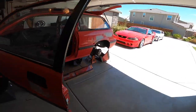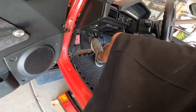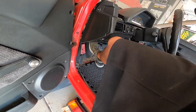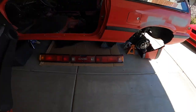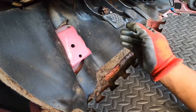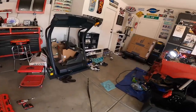The best time to adjust it is when you run the car, because you'll know when the clutch grabs. For now, press on the pedal and make sure it feels like there's tension on there. There's a little bit of a dead spot before it starts to catch, so it's just a matter of tightening it down. The pedal adjustment bolt is more for where the pedal stops — there's actually a little standoff bolt you can adjust to control how far back the pedal stops if you think the pedal is coming too far out.